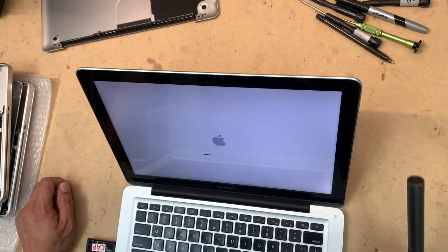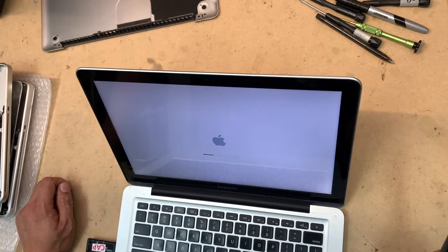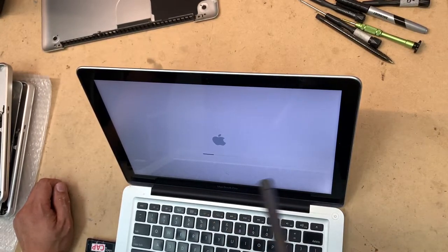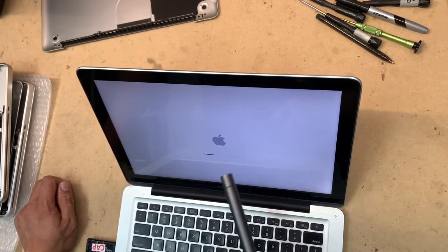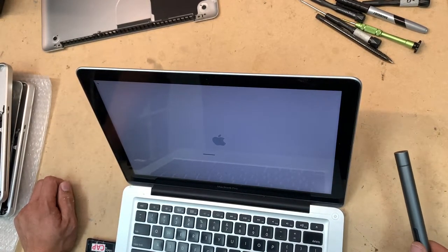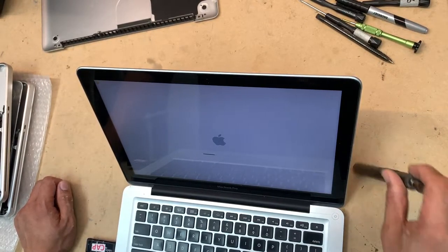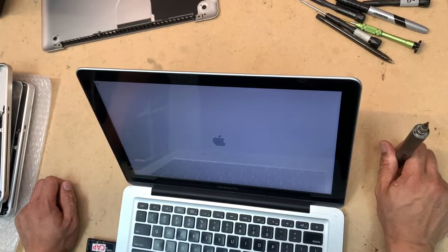and that's it. But if you don't have the USB, which apparently you can get for some $15 on eBay, you can just select the internet Wi-Fi at the bottom of where you selected this USB on the screens, the options that came up after pressing and holding the option key, and connect to the internet, and it will download the most compatible version of the operating system for your Mac. But I don't have that problem, so